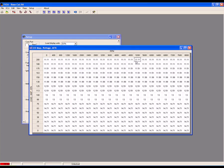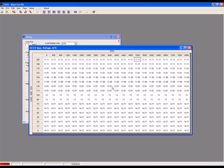Now we need to compensate for these richer air-fuel ratios by adjusting the fuel table. This next step is extremely important but often overlooked. By making the ECU's target air-fuel ratio more rich, it will sense that the current condition is too lean and fuel trims will increase to make the actual air-fuel ratio match the desired target. Over time, short-term fuel trim changes will influence long-term fuel trims and the changes made in the O2 map will eventually be trimmed out.